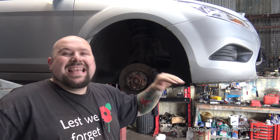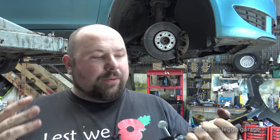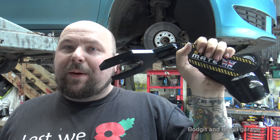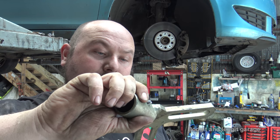Now it's only designed for what I've showed you — it's not designed to compress the spring. Bear that in mind, because I know people think it will, and it's just not designed to do that. You're going to cause damage to yourself or the car, so don't do it. If you want to compress the spring, you want to use this fellow, which is the WW3200.